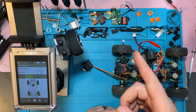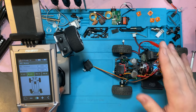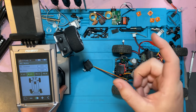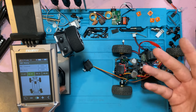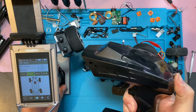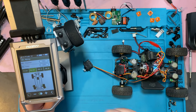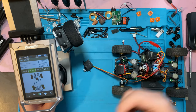Those are the options I know of on four-wheel steering and how to set it up. I'm sure there are other ones out there and other companies making little four-wheel steer modules. It's not hard to do. If you want just the basic four-wheel steering with the stock remote, that's pretty easy — just channel three. And even if you have an aftermarket transmitter, as long as you have a channel three with a three-position setting, you can set it up easily as well. I hope you got some great information from this video on how to get four-wheel steering onto your rig and find the right solution for you.